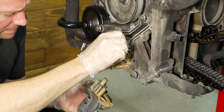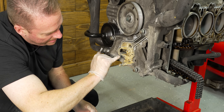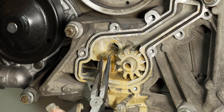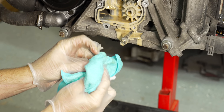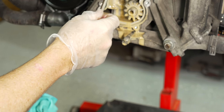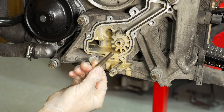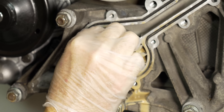We're going to check the hex key and the spring. Here's the hex key — let's go ahead and pull this out and see if it's broken or has any issues. This one is not broken. You can see it doesn't really have any wear. You could actually do this in the car — you have to take the back bumper off and the inner crash bar, and you could do this right from the back with very little effort. So if you're having low oil pressure, check this. The key is good, not a lot of wear on it.